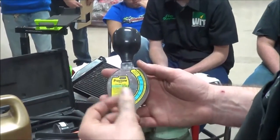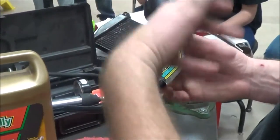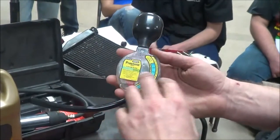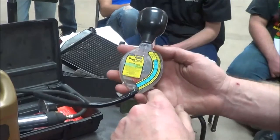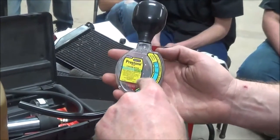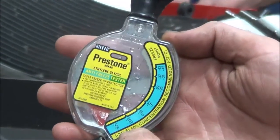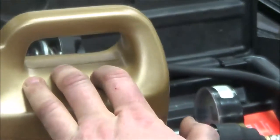You have the ones that use floating balls — if five balls float, it's at this degree of freezing, four balls and so on. I really like this one; it's been my favorite for testing. It shows Celsius and Fahrenheit, and it says that minus 34 degrees corresponds to a 50% mix — half water, half coolant.